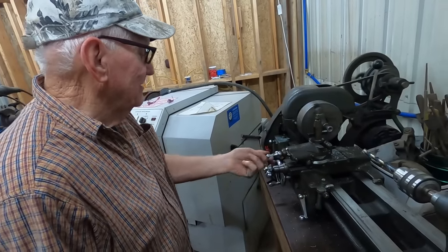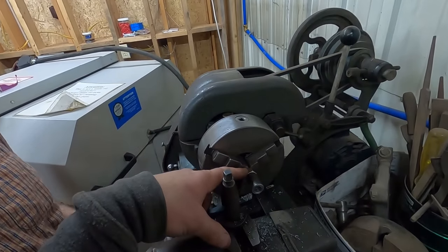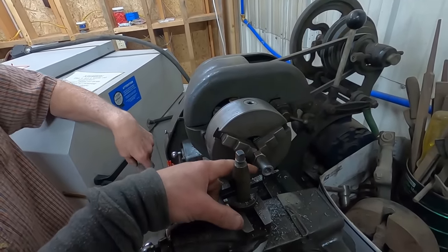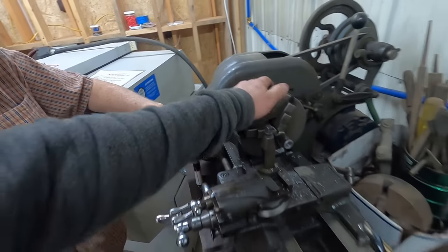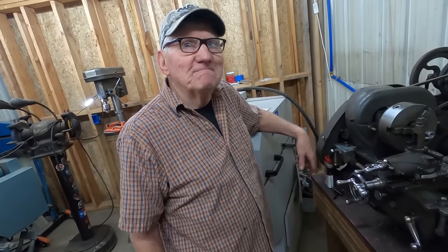Your trifocals. My bifocals. So, we're whittling down a threaded adapter to go on the shift knob with a jam nut to this sleeve that goes on there. And then this sleeve's got a hole where we can pin it in place. So, then you don't need a tool. You just grab the knob, right? So hey, we can play with our knob all day long.